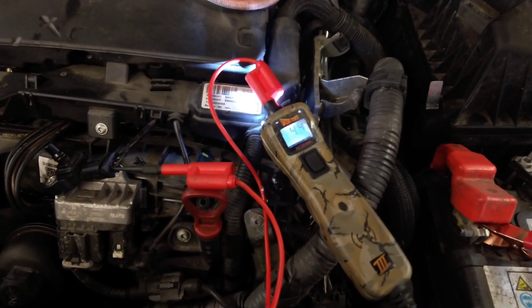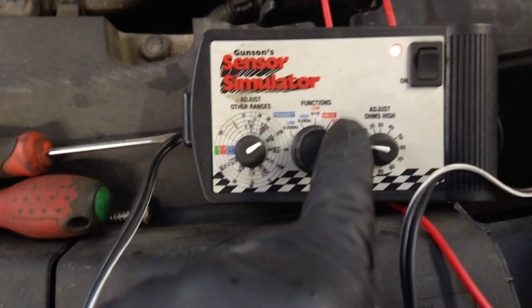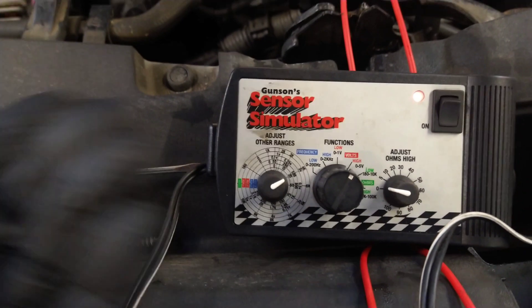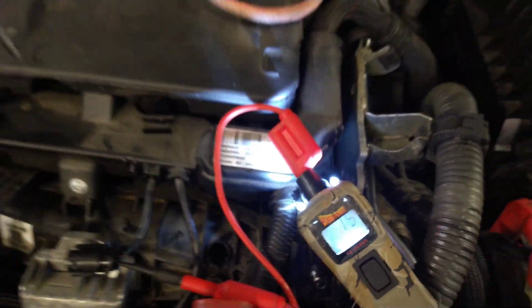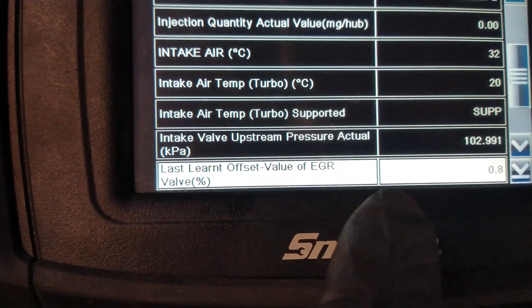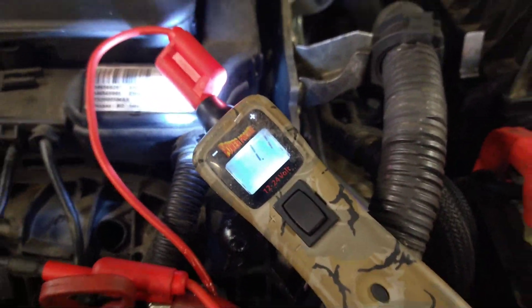Using this old school sensor simulator on the voltage high setting, I've got it set for 0-5 volts. At the moment it's at 1.5 volts. Checking the actual KPA reading — so I've got that adjusted correctly and I had to put this to 1.1.